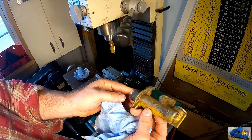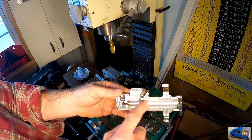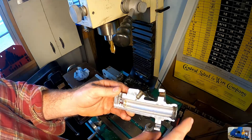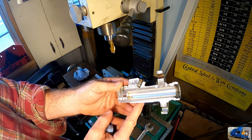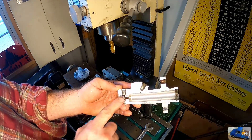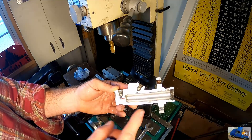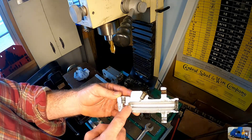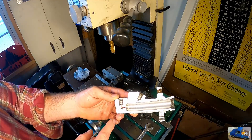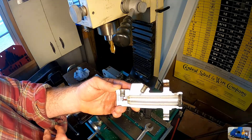There you have it. We machined the bore out so she's nice — no more pits — and milled her in half. You can see all the ports: this is the feed, that's the pressure line. Now if we can find all the pieces and deburr this, we'll put it all together and show you how it actually functions when you push the pedal.